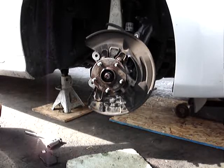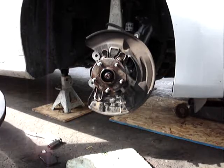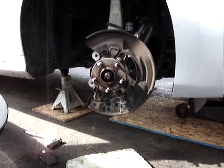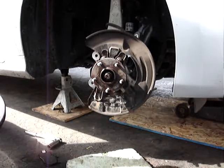which would be a good time to note, at least on this vehicle, this GS350, the left front rotor and the right front rotor are different part numbers. They are actually marked left and right. So aftermarket parts wise, you're just hardly ever going to find that distinction between the two. So make sure that you get the right parts and put the right rotors on.